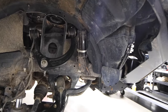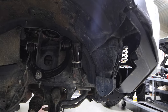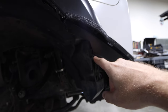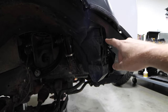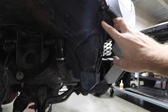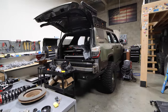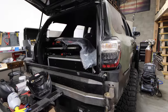Surprisingly, zero rubbing anywhere on top — that means my bump stops are set correctly. The Southern Style wings have a little lip; I cut them up by about an inch and I'm no longer rubbing. I do have a little bit of paint flakes, so maybe I touched that corner once, but I'm not concerned. This is the green 4Runner with 35s, which I'll show you right now.